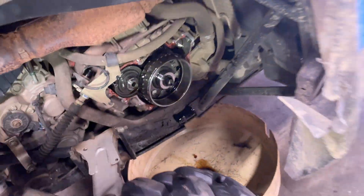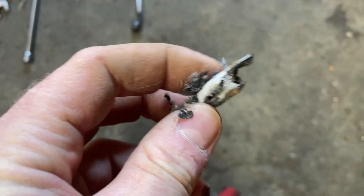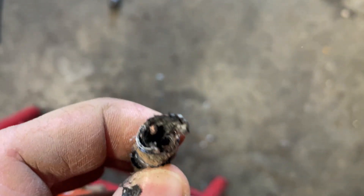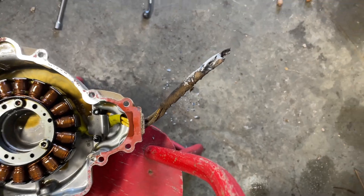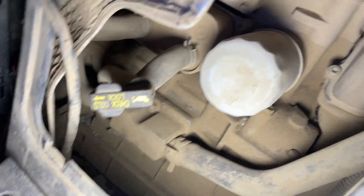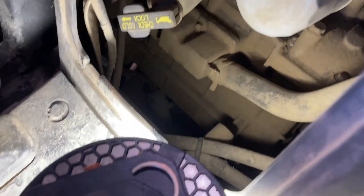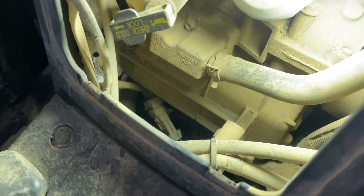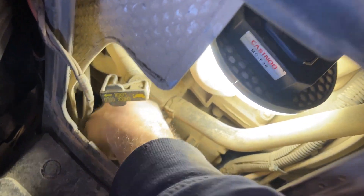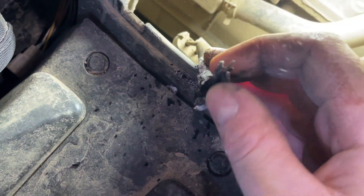With the cover pulled off — a couple bolts for the bracket, the shifter sensor — I pulled all the bolts out and lifted it off. I was surprised to see the wire just come apart like that — it looks burned, like it got hot somehow. If you go in between the seats and take the panel off where your oil filler is, you'll see the stator plug down there. If you grab that end of the wire, you'll see what we had: crispy, charred wire, completely burned. So we can unplug this bad boy.